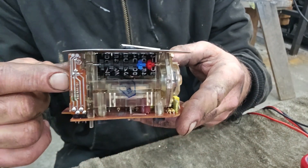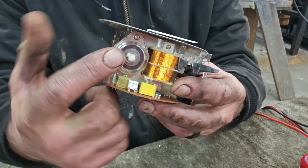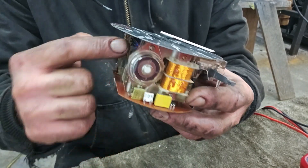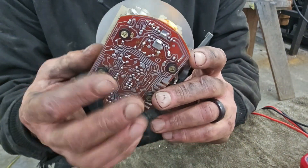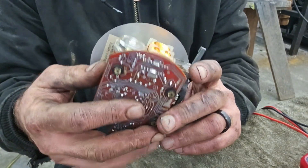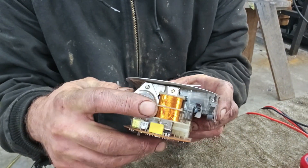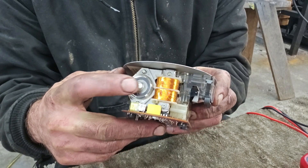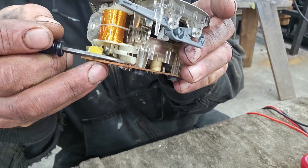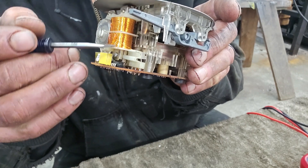The smallest gear has a rod that goes across it. That rod comes into this magnet assembly, and this thing is like a motor — it spins the gears. So as I said, there can be a lot of problems; a lot of issues were found in solder joints and similar areas. But I'm showing you my specific issue. I knew this gear wasn't turning, so I looked at the coil — this is essentially the motor, and these are the windings for the motor.